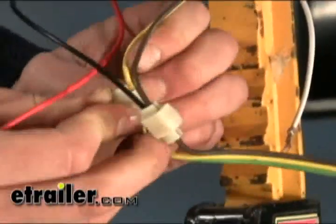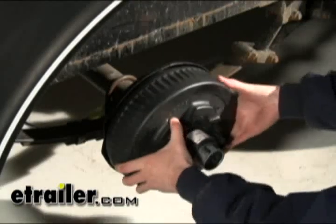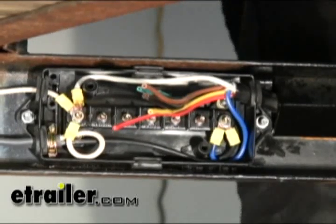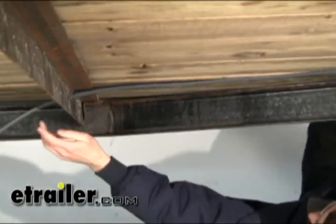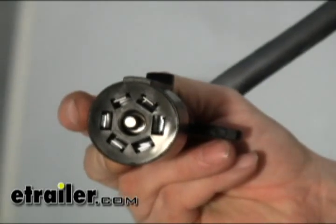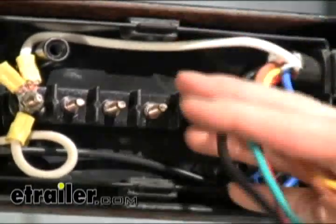In this edition of this little trailer, we're going to wire up the lights. Previously, we had hooked up electric brakes — we have the junction box installed and wires run for electric brakes, but nothing for the actual taillights themselves. Today we're going to hook up our 7-pole wiring harness with the molded connector and connect that to our junction box installed in the frame.